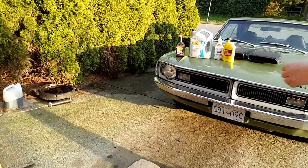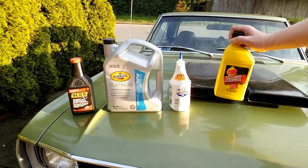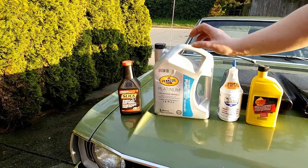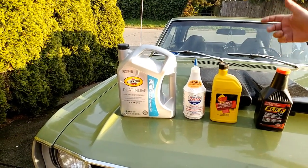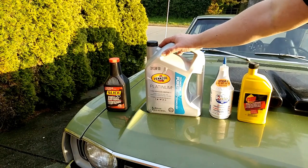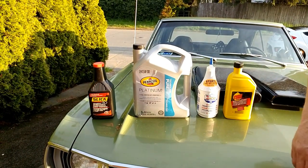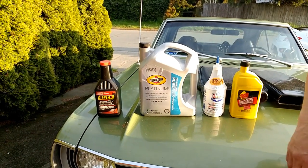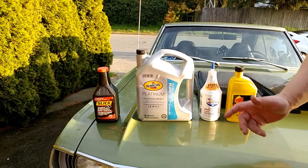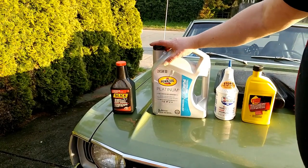Now this is my recipe. Everything I have with gas — my lawn mower, my pressure washer — I put in some Duralube. This protects the metal. I also run synthetic oil or you can use Slick 50, one or the other. Your lawn mower manual says it needs 30 weight oil, so this is an actual 30 weight. The 5W just means it's good to a certain temperature below zero, so don't worry about that number. I guarantee synthetic oil is going to be way better — it'll keep your motor cooler and run a little bit smoother.